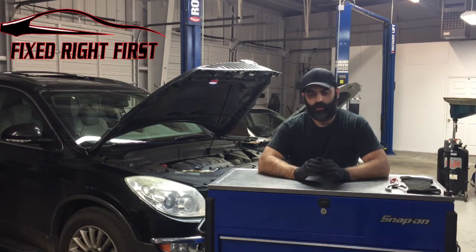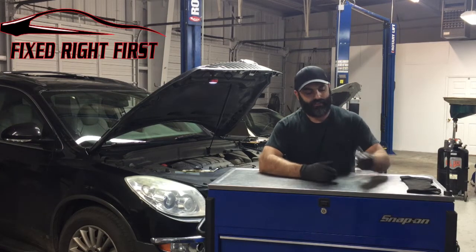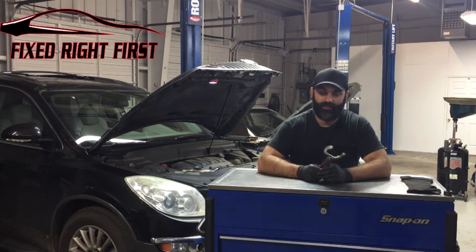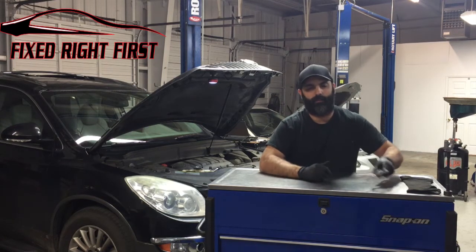Sometimes the oil filter can be over tightened if somebody else puts it on and uses some kind of wrench or a strap to tighten it up, where they didn't go hand tight, or sometimes Hercules puts them on. If that's the case, I really recommend getting a pair of these oil filter pliers. They work great on this application because you can use them from the top.